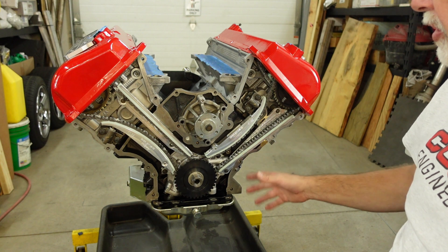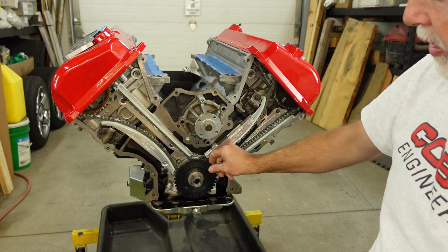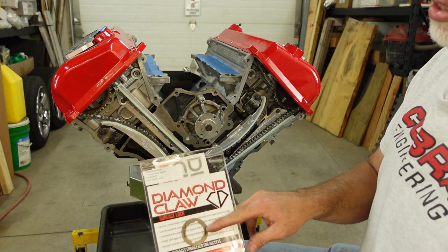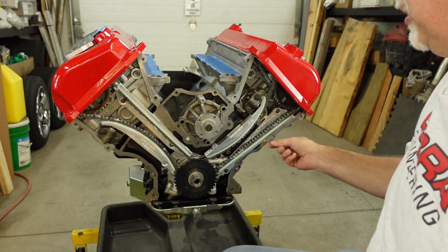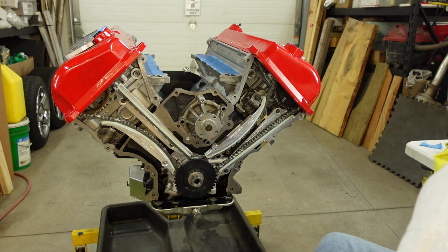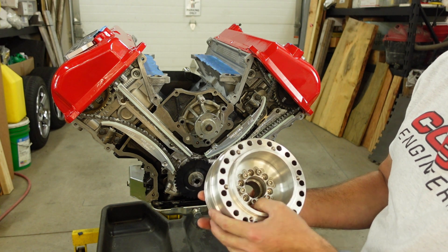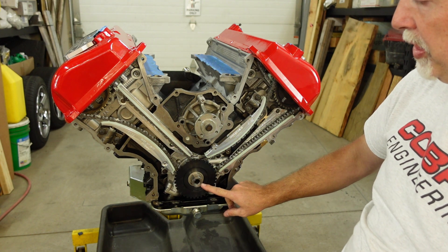Here you can see I got the front cover off the engine still, but I've got everything degreed. I've got our Shelby mic billet guides and a billet reluctor wheel. What we're trying new on this engine are these diamond claw washers — they're only 10 thou thick. There's one behind the main crank sprocket to the crank, sandwiched between there, then one between the crank sprocket and the reluctor wheel, and the final one will be between the reluctor wheel and the dampener. Notice I got the key extended all the way out — that's the full length of this hub for this dampener. That keyway is a full cut keyway. I'm only running one keyway with these washers — I don't want to weaken the crank with a second keyway.